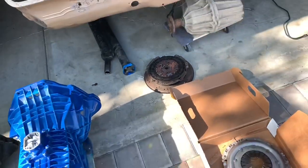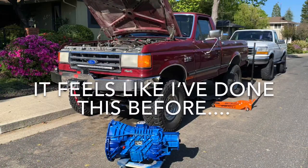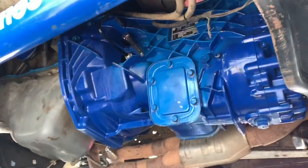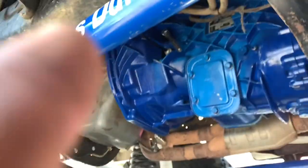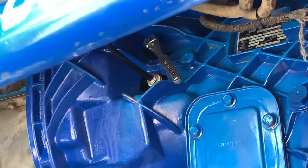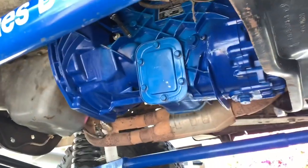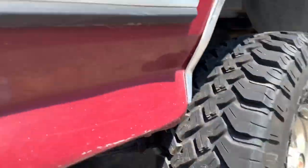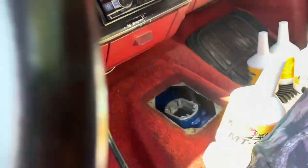You can tell that'll be a lot nicer in there. Got a heavy-duty 11-inch clutch for it, new flywheel. That's the old clutch. Going to start throwing everything in right now. The transmission's in, transfer case is in, just got to bolt up the drive shafts. It went pretty well, except the clutch line — it wasn't the right one because I had a 1991 clutch line and a 1997 slave cylinder, because the transmission's a '97, and the fittings do not connect. So I had to Dremel the fitting to fit in. I think it'll be good. Just got to bleed the clutch, filling the transmission up with MT90 — the good stuff — and then put the shifter all in, drive shafts, bleed the clutch, and then test drive.